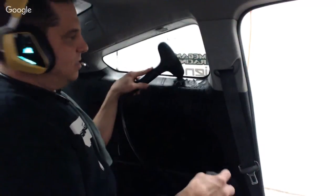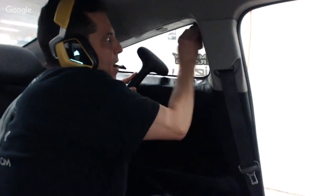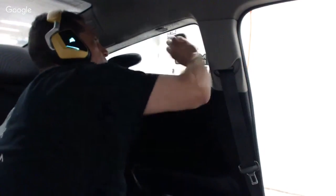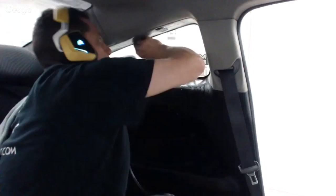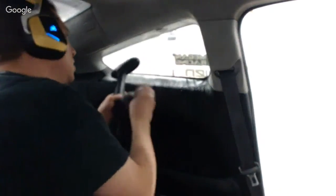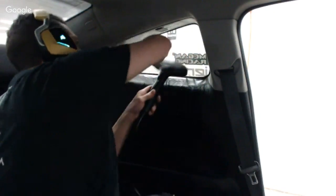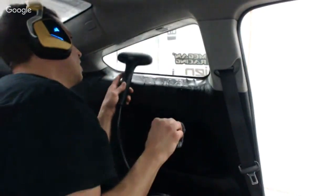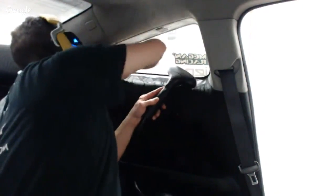Like I said, you can use razor blades on here and shave it off the old-fashioned way. Sometimes I'll do that, like if I'm in a pinch and I have to strip a little something, maybe I'm only doing one window. I'm not going to put all the time and effort into firing up my steamer for a one window redo. Then I'll just use the razor blades in the old-fashioned method. You spray the window down, make sure you have sharp, fresh razor blades, and you scrape and wipe on the paper towel, scrape another path, wipe on the paper towel. I will use that method sometimes.